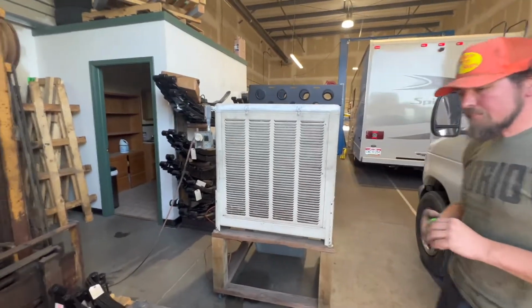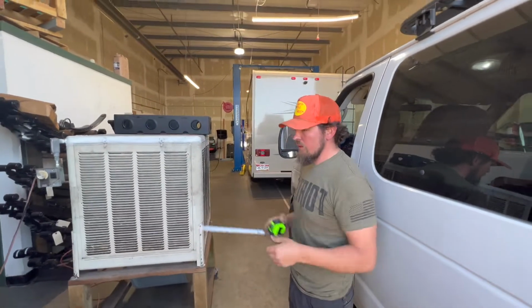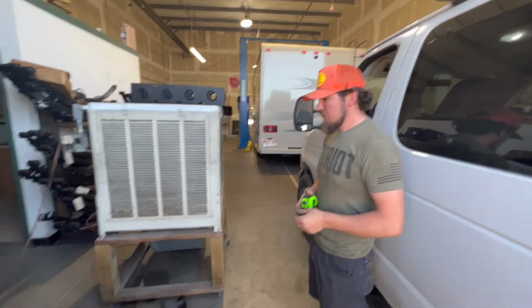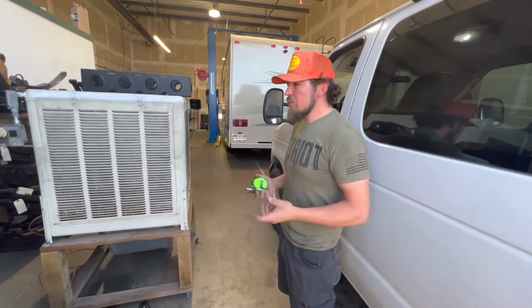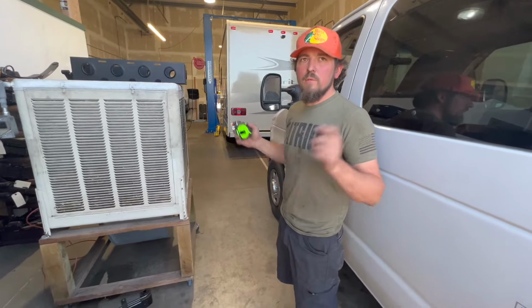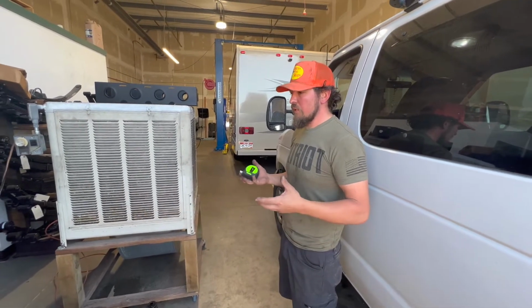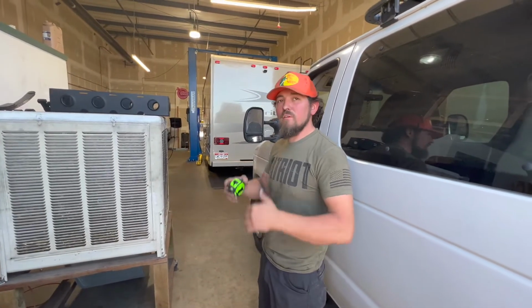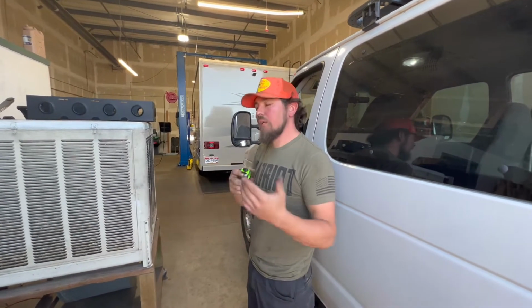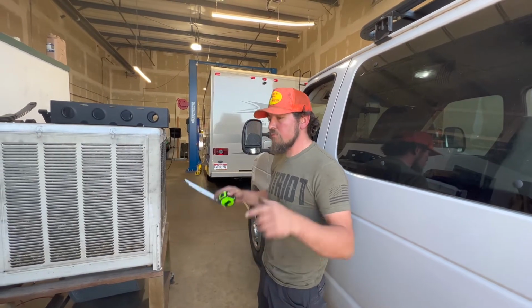So it's not just necessarily how many packs, how many springs are in there. It's how far they are arched. And the front ones, how big are those? They're going to be about the same as well. It's all going to be built mainly into the arch. The spring steel is a little bit different, so they're going to be able to handle a little bit more weight. The lift itself, instead of using lift blocks like other brands and other lift kits, we actually get all of our lift from the spring itself.